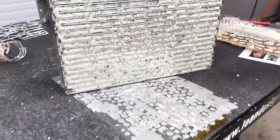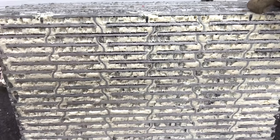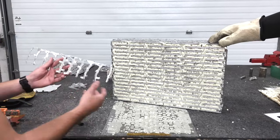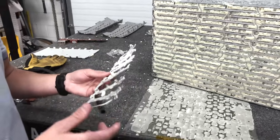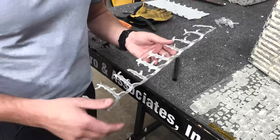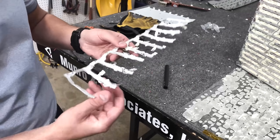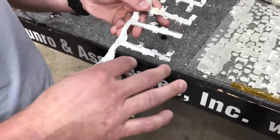This is how the current collector is actually attached, as opposed to our torn-apart view. We have four cells in a brick and they go down the entire length of the module — that gives us a 72 parallel. This is an example of all those current collector arrays pulled out. The current collector itself is just a stamped aluminum component — the primary structure that's going to carry the majority of the current is a stamped aluminum bar. Over the top of that are very thin tabs — think of aluminum foil almost, that's about the thickness — that appear to have these modules attached.